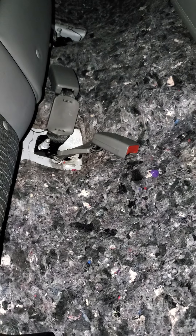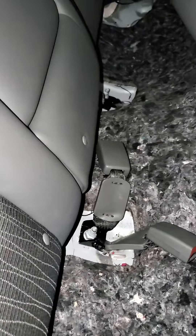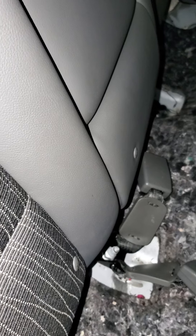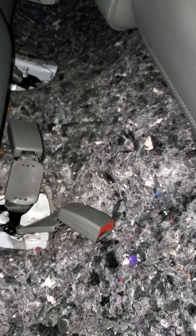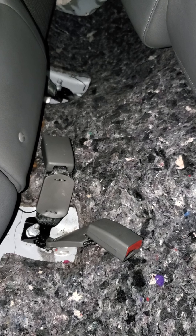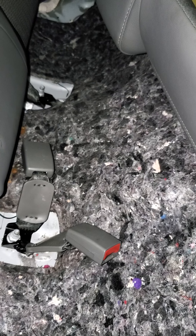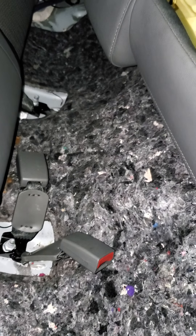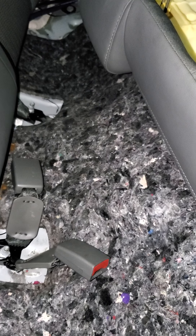They had given me the problem. I took them off and put dummy plugs on — it was a lining issue. It wasn't creating a seal, so when you hit the brakes, the water from inside the spare tire area would rush in here, and then when you hit the brakes again it would leak all the way into the car. So if you have a 2014 Chevy Impala and your floors are wet in the rear, you smell mildew — your problem is your rear light seals are bad. Go on eBay or Amazon, get some new seals for your rear lights, put them on, and you're done.